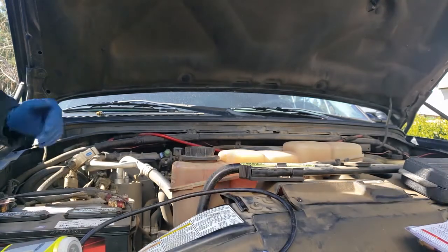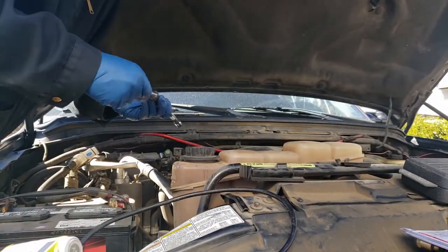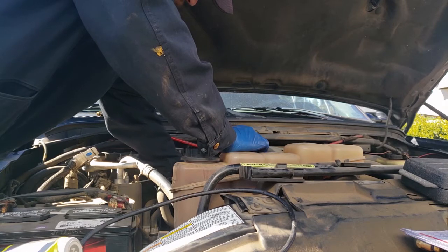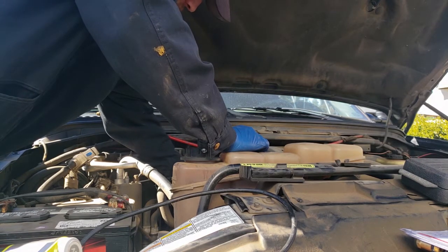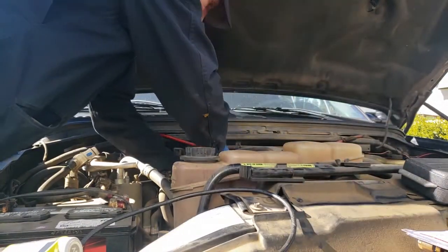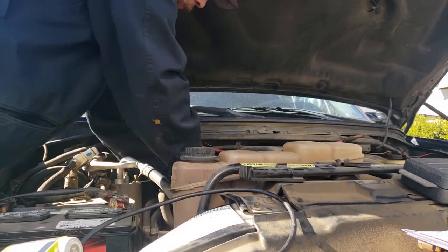So it means to me that the electrode from the old spark plug, the one that's screwed up, got somehow sandwiched between the valves and the cylinder head. Which, back to the cylinder head, there's several options I can do. If the cylinder head is salvageable, if it's okay, then we can have it just rebuilt, and that's fine. It'd probably be about $200-$250. But if it's not salvageable, a replacement from Summit Racing is about $450-$500. And that's on top of the about $1,400 it's gonna cost me to have this cylinder head removed.